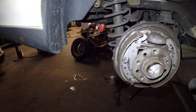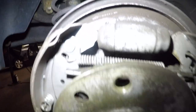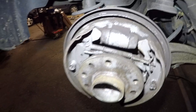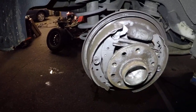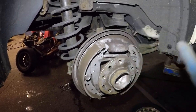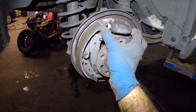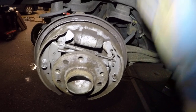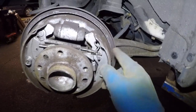Let me go back — I cleaned the drum already, I should have waited. You see this right here? There's a hell of a brake dust in here, that's gonna cause some type of issue. You see it's all falling. If the drum spins this way when the car is moving forward, the brakes are gonna open up like so, and this end is gonna be the one taking damage because it's gonna be getting hit this way.